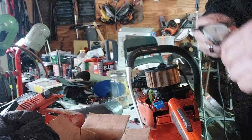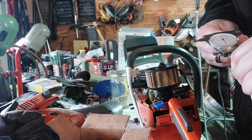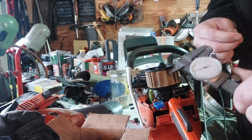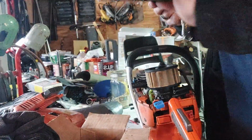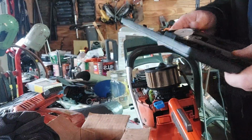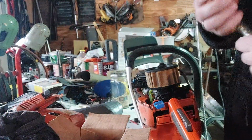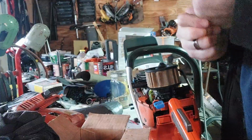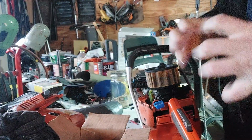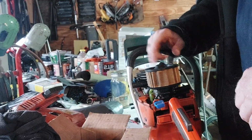Let's see here. What do we get? 18, 23, 21. Yeah, 18 to 20. For such a big saw, it's pretty tight, let me tell you. I would like to see something along the lines of, I don't know, 22 thousandths, 24 thousandths. It's got mad compression. You can't pull it over without hitting the decomp. But it's a runner, let me tell you. Runs real nice.